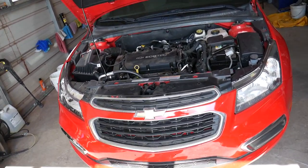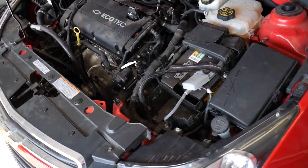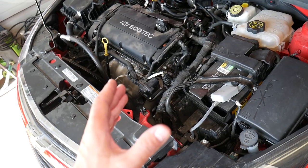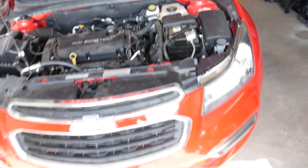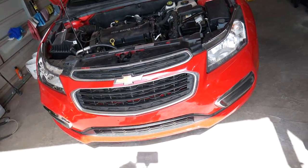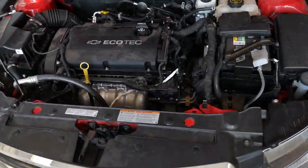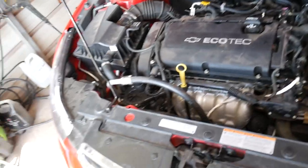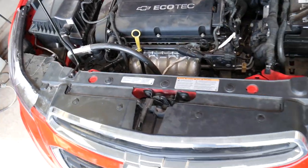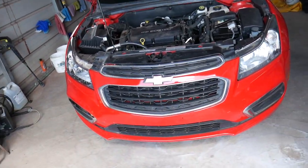So what is happening if you get that negative 40 is that either the ambient air temperature sensor is not working, or it's disconnected, or the wiring harness got damaged. And it could happen very easily on a Chevy vehicle, and we'll explain how it affects your car. The engine computer on your Chevy or GMC vehicle reads that ambient air temperature sensor, and it needs all that data so it can adjust the way the engine runs for AC, for cooling and all that stuff as well. And if that sensor is not working, sometimes your AC will not work, sometimes even your radiator fan may stay on.